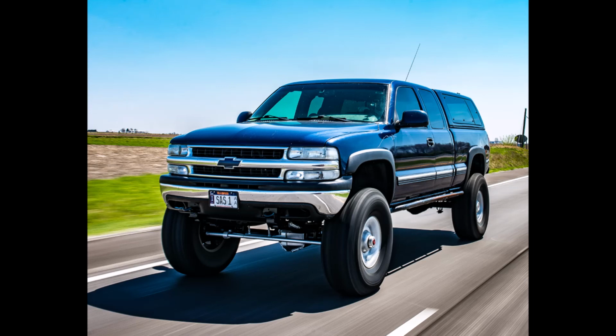Right now, it's at Mike's house in his shop. I'm in the process of getting the whole back end done: faux floor, outer and inner wheel wells, all that sheet metal. Basically tubs from one side of the vehicle to the other. One tub, but it's not a simple throw-it-in-there. It's a jacuzzi tub. I raised the fuel tank to the inside. I cut a hole in the floor and dropped the fuel tank in from the top side, and then I've built a false floor out of 1x1 square tube, and then I'm putting sheet metal in that and getting that all figured out. But man, I did all the easy pieces.